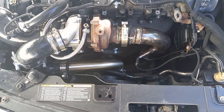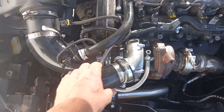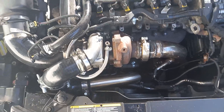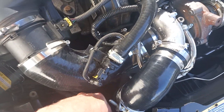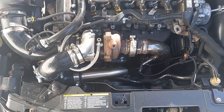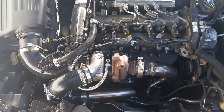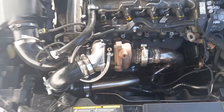This entire section will obviously be covered in the heat shield, which should be fitted later on this week. The compressor outlet from the turbo itself is at a different angle to the one normally found on the Insignia, so we had to modify a pipe to come out of there and down into the standard intercooler piping. It's possible with a little extra time we could route it more directly, which might improve boost delivery time slightly, but it won't be a huge amount — and bearing in mind the ball bearing turbo already spools up much faster anyway.